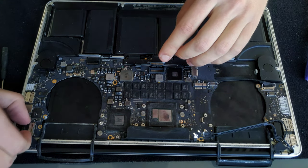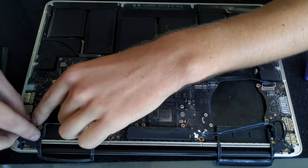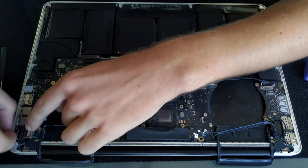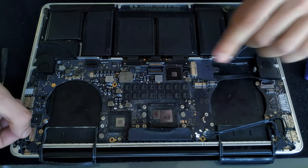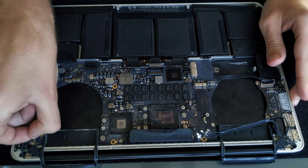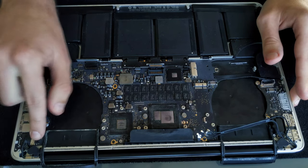Then a little bit more tricky — the microphone connector: just push it into the housing and then close the arm. Be really careful with the screen connector and do not apply too much force on the cable. Let the cable route the same way as it was before, because if you don't you might end up with a bent pin on the connector if the cable is torquing it.